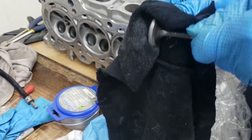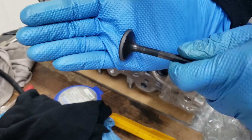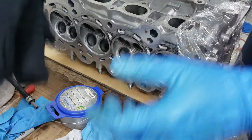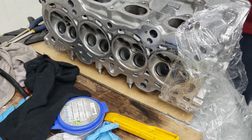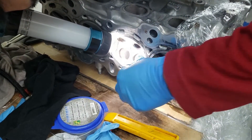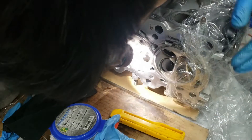Let's wipe this valve up. The surface looks good on this one — it's hard to see because of the lighting, but the surface looks good. Now let's check the seat on the head. That surface looks pretty good too. I like to shine a light on it to get a good clear look. There's still some pitting on this side, so we could go a little bit more — still slight pitting, so we'll do another round of grinding.